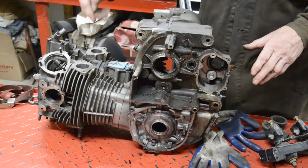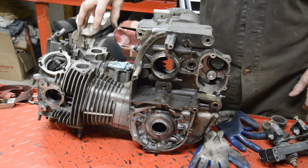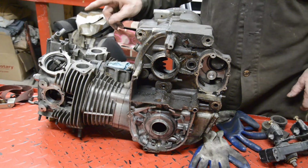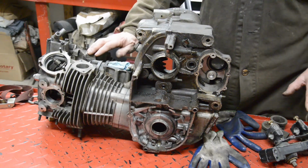And having those two, it was actually just the diaphragms that fouled on the frame. So I made a manifold up and put one carb on. I did that because it was cheap. I made the manifold up, I used one of the Yamaha's twin carbs, and the bike ran beautifully.